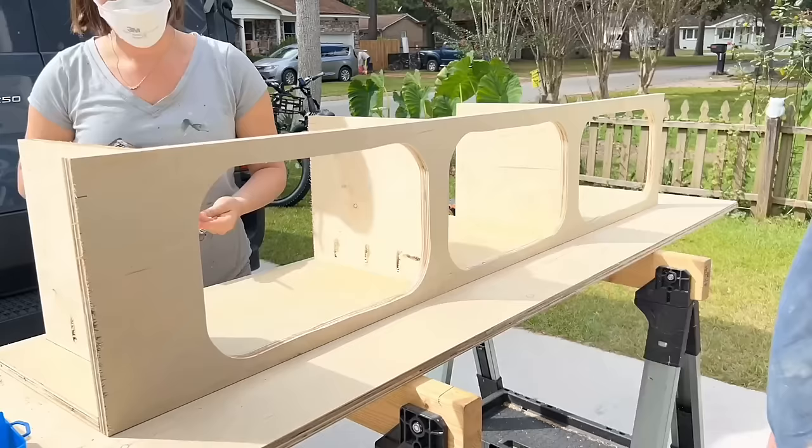The next day I measured and cut out a hole for the sink and cut out the door that opens to access the 12-volt fridge. I gave the entire countertop a light sanding with 220-grit sandpaper before staining it. To make the fridge door open and close, I installed a piano hinge, then brought it over to the camper to confirm fit before installing and wiring up the water pump — a 2.5-gallon-per-minute, 12-volt pump. I used lever nuts for the connections so the pump can be replaced without cutting wires. The last step was to install the trim piece holding the battery monitor and 120-volt outlet.